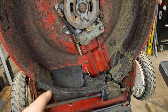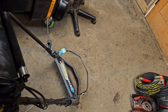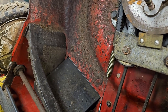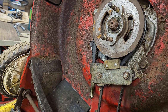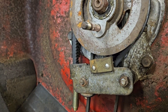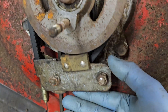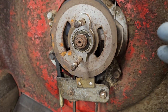When you let go of that lever, this piece swings back forward allowing the belt to be loose. There's actually a little brake pad right here that rubs on this lower sheave to stop the blade. When all this is working properly, this is what it's supposed to look like. As I'm stepping on it — see how that piece right there pulls down and stretches the belt — and as I release, it returns back.